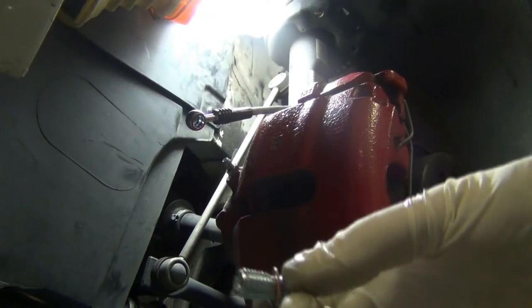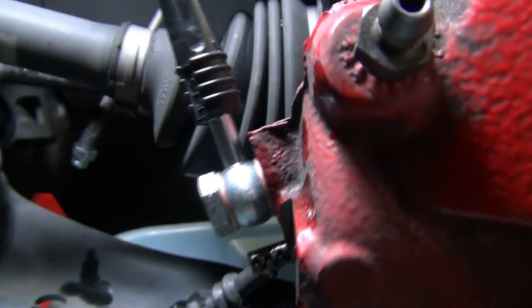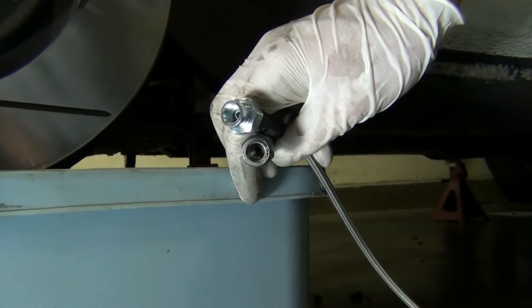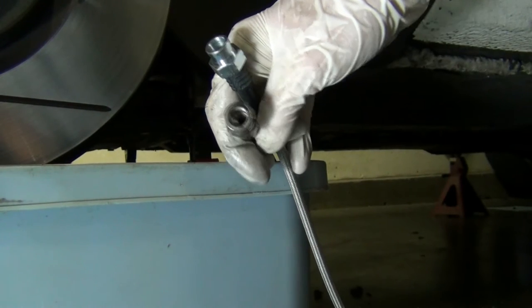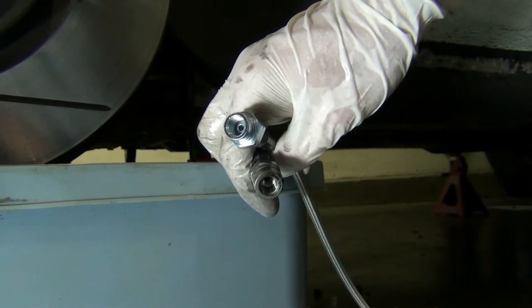Some more obvious stuff — make sure you put your copper O-ring on one side of the banjo, then your other copper O-ring, then go ahead and screw it in. One small thing you're losing is that this brake line doesn't have a notch to hold it against the holder so it doesn't pivot, but no big deal — just make sure it's tight. Your new banjos are 14mm, so make sure you have the right wrench. Don't be surprised if your top fitting doesn't go in very far; this new hose is about half as deep as the other one, so it'll only screw in about halfway — it kind of tricks you, but it looks like it is in far enough.